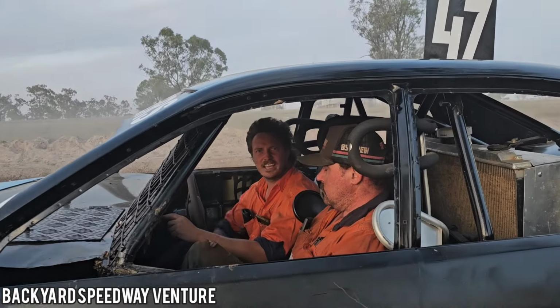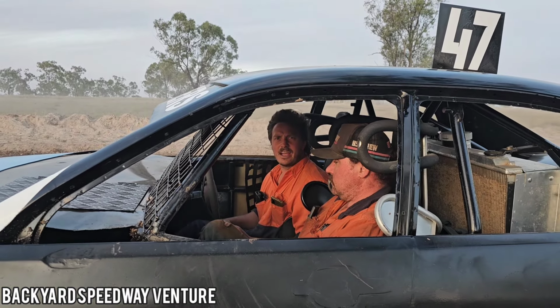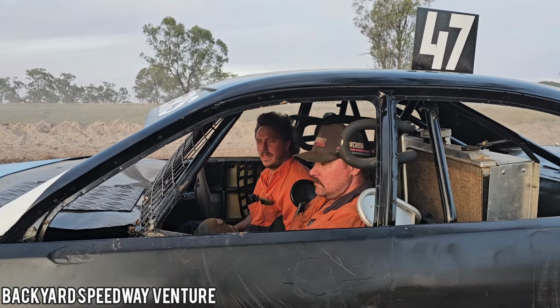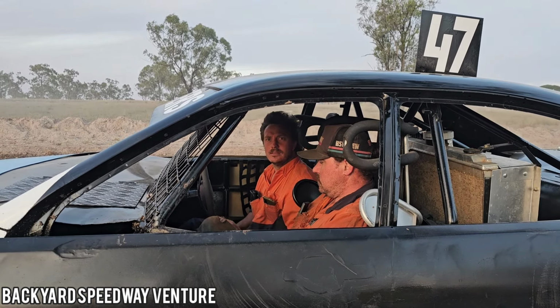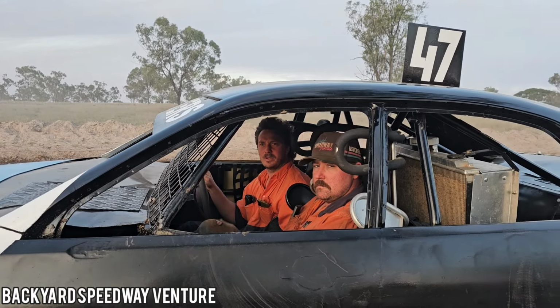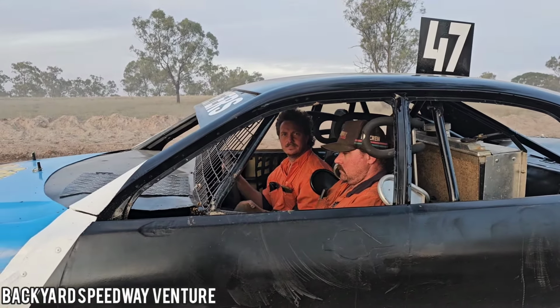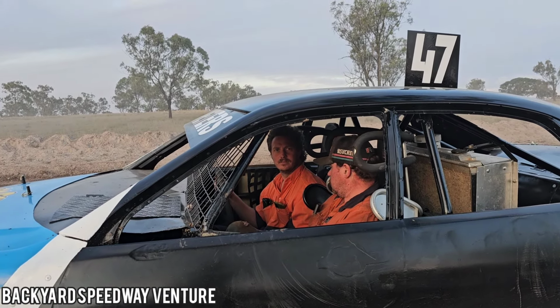It's not working. What's not working? It's like missing and carrying on when you're wide open throttle. It is running way too rich still. So mate, I'm hoping that that's it. When you really squeeze the pedal on it, it starts missing. But it hasn't got a miss.